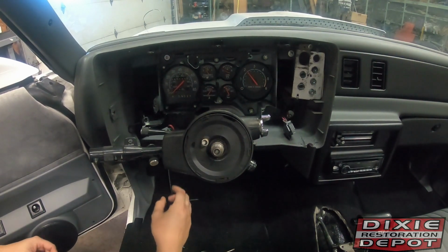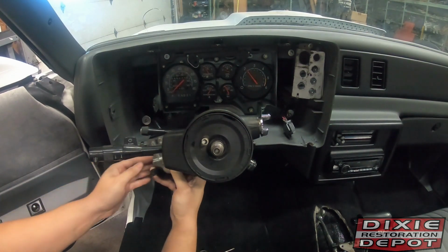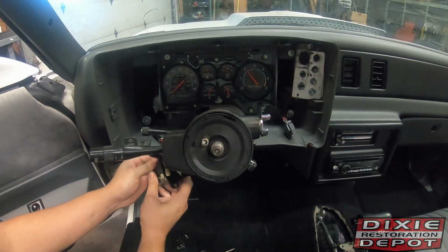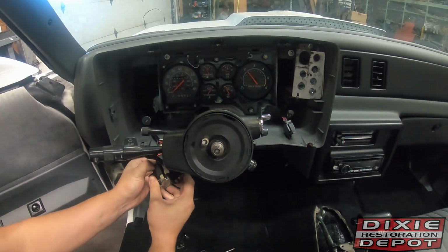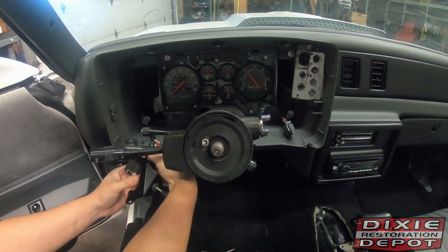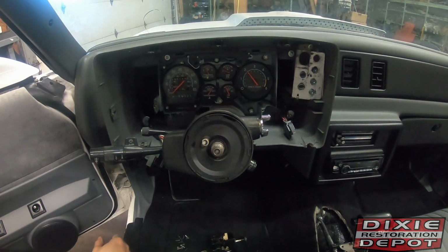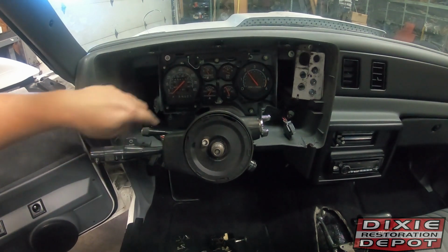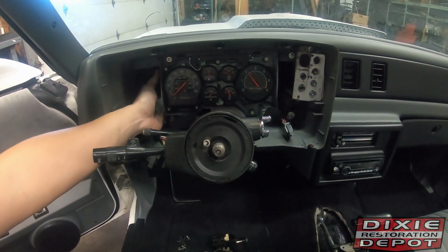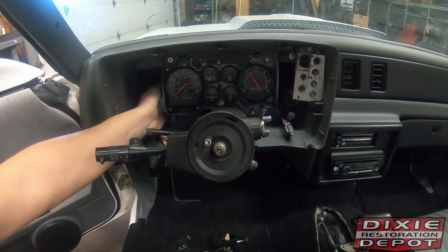As far as the headlight switch removal goes, it's pretty simple. There's your connector here. Usually they'll just pull off. Ours is stubborn. Set that aside. And then you have 4 screws, essentially 1 in each corner. And as far as the speedometer, the cable comes around back. Reach back here and make sure you undo the clip for the speedometer cable.